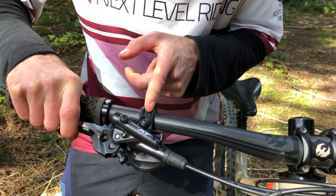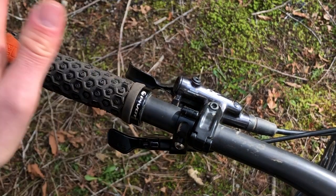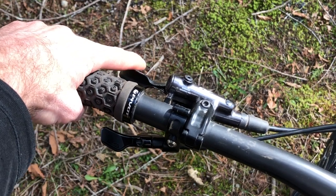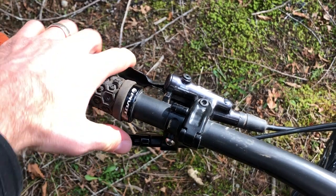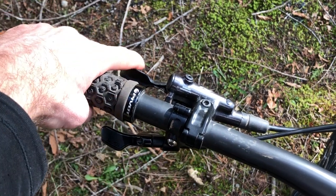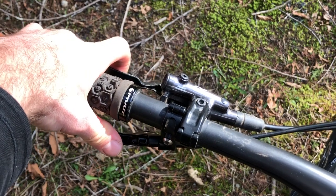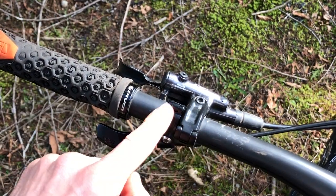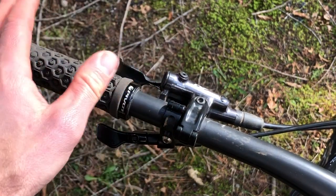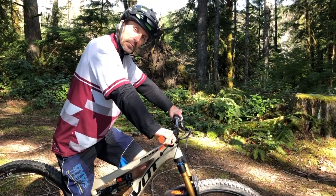Make sure that you're only pulling the lever with one finger by positioning it in the right spot. You also need to think about the shift lever and the dropper seat post lever — where those are positioned so that you can reach them. Once you've set the brake lever in the right position, make sure the dropper lever is also in the right position. Sometimes people have the dropper lever on the other side of the brake lever and it ends up too far away. Everyone's bike is different, so just make sure you can reach both levers easily and feel free to move them around. Note that many levers don't slide off without removing the grip first.